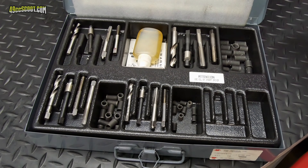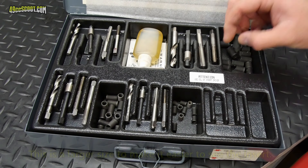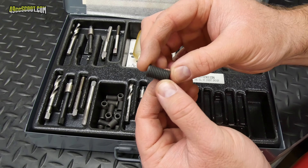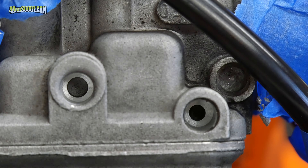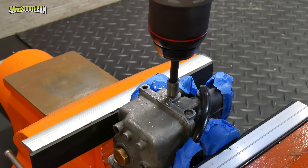The first thing I wanted to figure out was how to mount a bracket to the carb. There are two holes on one side that lead to nowhere, which I assume were cast in for alternate configurations — they have no threads inside. So I installed M6x1.0 threaded inserts called TimeSerts. The drill size for the inserts was just larger than the holes, so I barely had to remove any material, and M6x1.0 is the most commonly used fastener size on most small scooters, so I have a bunch of different bolts on hand.